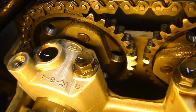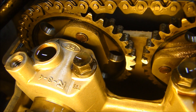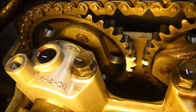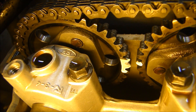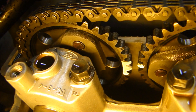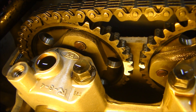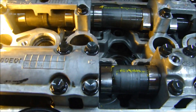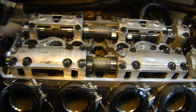Here's a quick note — there are no doubt manufactured timing marks on each timing gear to correspond with the crankshaft. However, if I do not move the crankshaft and leave the valves where they were, I can put these cams exactly back where they were. You can see I put these white marks on there. The white mark on the right is on a tooth, and the white marks on the left are on two teeth. So when I put this back together, those two teeth and that white tooth on the right should line up with the groove on the left. That's how I make sure I get the timing back where it was. I also put timing marks on top of the cams so I make sure the cams go back in the same position where they were when they started.